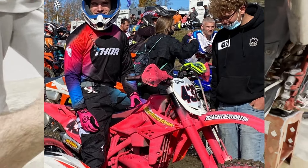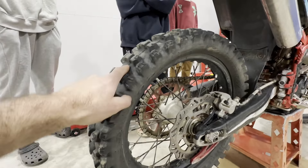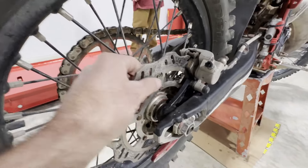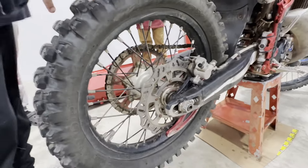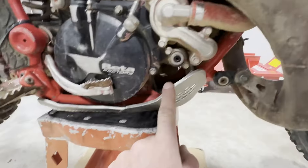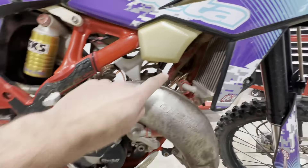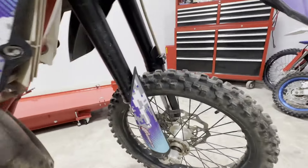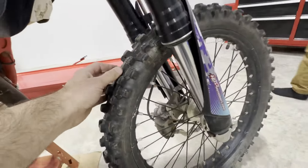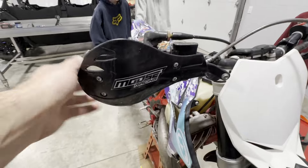It's like the original tire that Danny left on it. So aside from the motor, my initial thoughts are obviously a new tube and tire in the back. The chain and sprockets look really good, the brake pads are okay, and even the rotor is not too worn. It is pretty cool that it has the rear rotor guard already on it, and it has a nice Enduro Engineering skid plate with the linkage guard. It also has the CM Co. hose kit. It does have a nice front tire though — I think we'll be able to leave that on there for him. Front wheel bearings feel pretty good, front brake pads are good, and it does have the hand guards which are nice — we like these Moose ones, we'll leave those on.